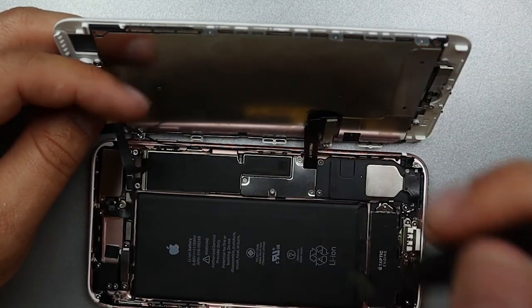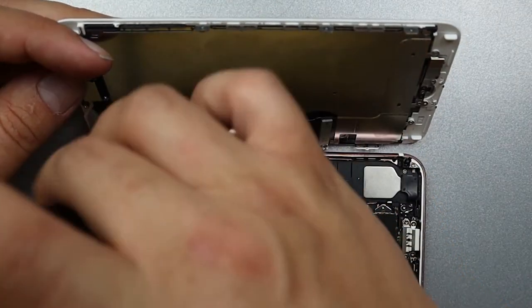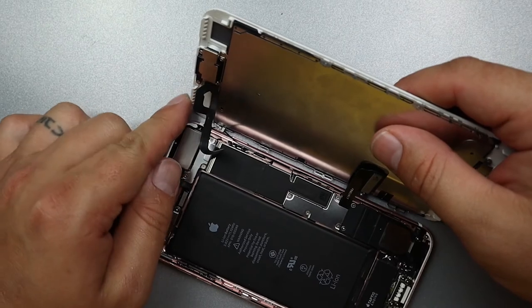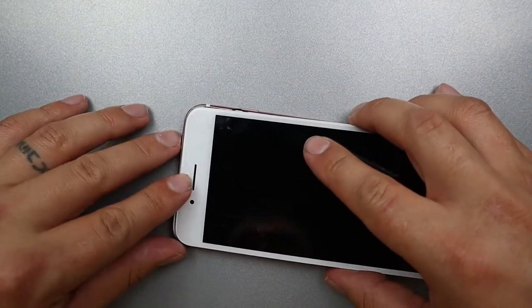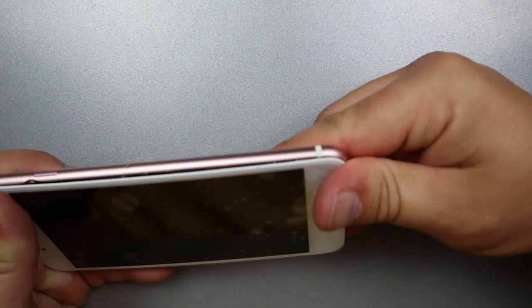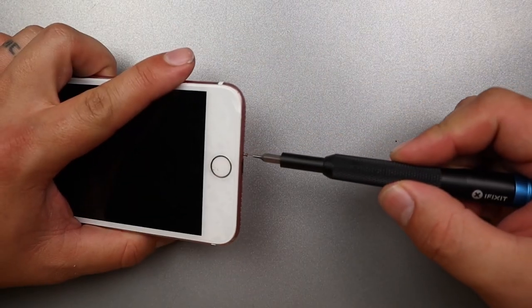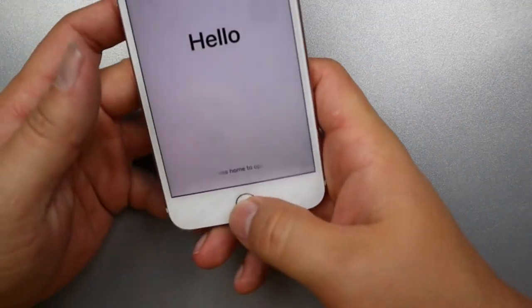Home button works, screen works. Go ahead and put the shield plate in for the battery — there are three small screws on this shield plate and then one long screw. Don't forget which one is your long screw. For the front camera shield plate — there we go. Now remember we have the flanges that have to slide into the frame, so we'll slide those in. I like to push the bottom of the screen in and then work the middle in. Then I'll use my pentalobe screwdriver and install the screws that hold the screen in place.